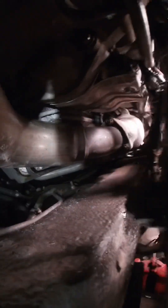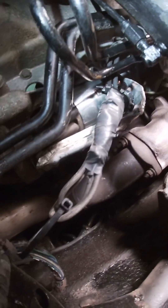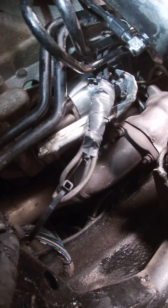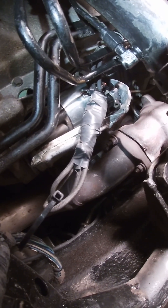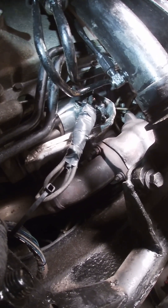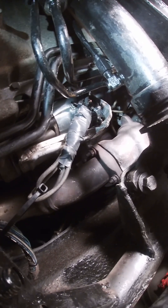It's rather hard to find everything, but there's the exhaust system — you don't have to touch the exhaust system at all. You can get round everything just about. That's the back end of the starter motor there. Now the connections on the Bentley are diabolical; the X5 comes with extended wires, heatproof ones that are shrouded, so I've used those and made the connections a lot longer — it makes life so much easier.